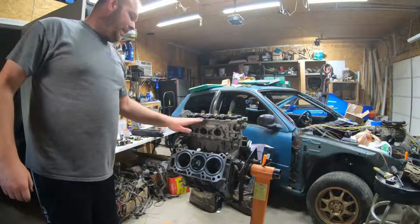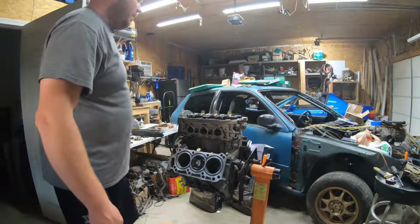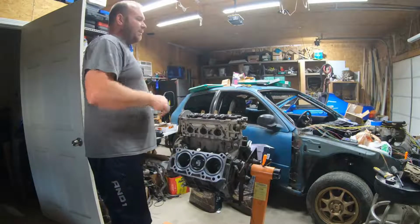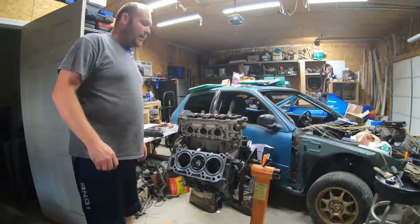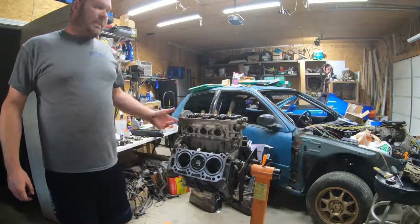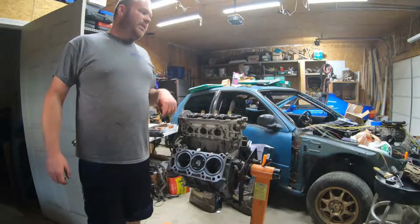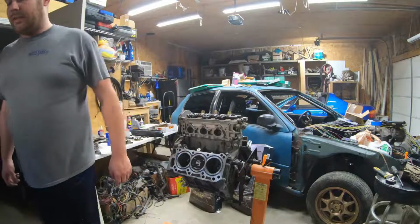And then the intake manifold, not the lower, but the next one, the middle one, I do that one like 3 times because I have that plastic heat gasket or whatever you want to call it. And that thing's soft, so I do it 3 times to make sure that it's good.